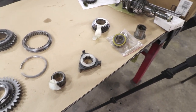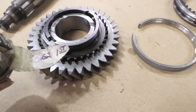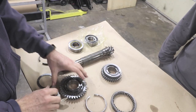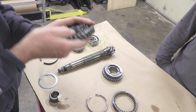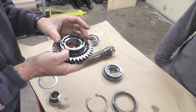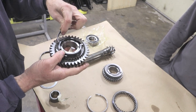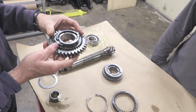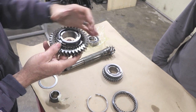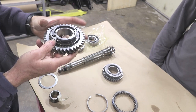Some of the biggest differences with the way Porsche evolved their transmission is here in first gear. This gear has good dog teeth — they're in good shape so we're going to use them as is. But this energizer block, stop block, and energizer band — this is the early style and there's really only one band, it goes here on the left. I had to look at the workshop manual for the orientation of all these parts because first gear is one that you typically just downshift into, so that's why there's only one band — it only has to energize in one direction.